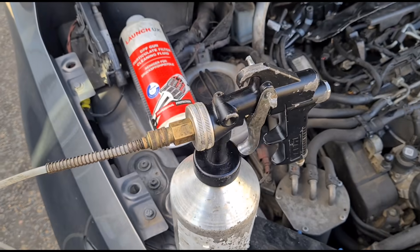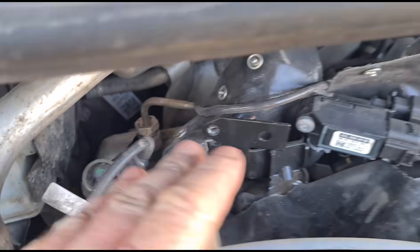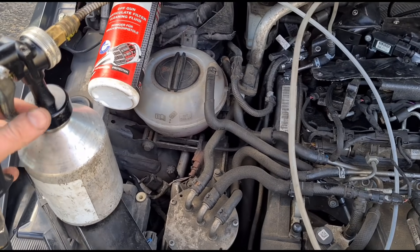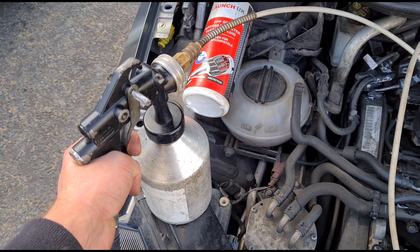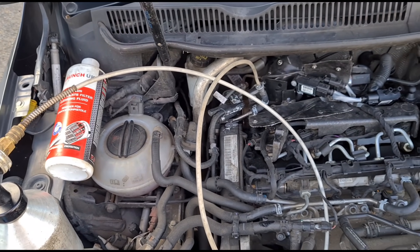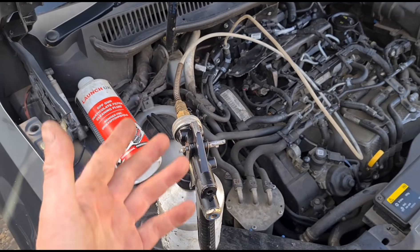Now I'm going to connect into the hose that goes to the DPF. On these VW vehicles the DPF sits right up high — it's actually higher than the cylinders. If you fill the DPF up too much with fluid, gravity will take course and it will go into the cylinders and you'll hydro-lock the engine. So I'm not going to put too much in with the engine off. I'm going to give it maybe a five to ten second burst of cleaning fluid, let that sit for about five minutes, and then do the rest with the engine running.